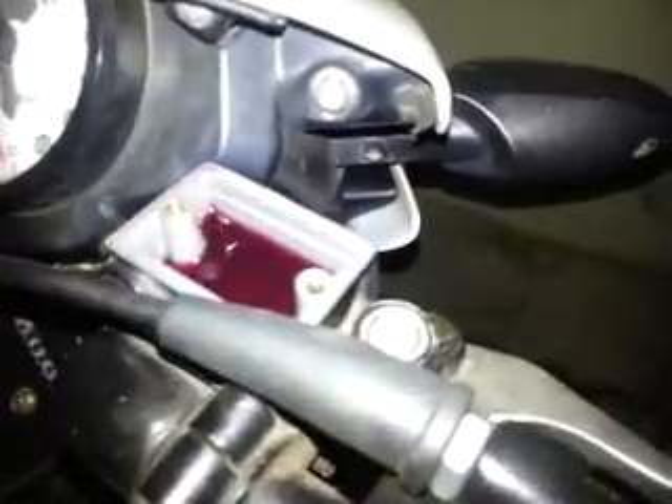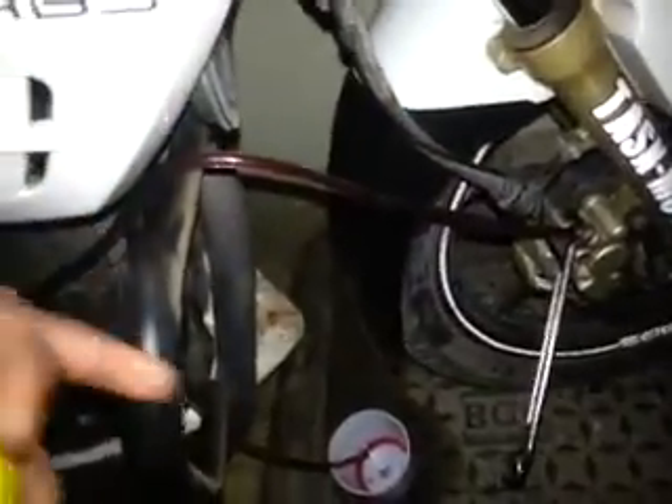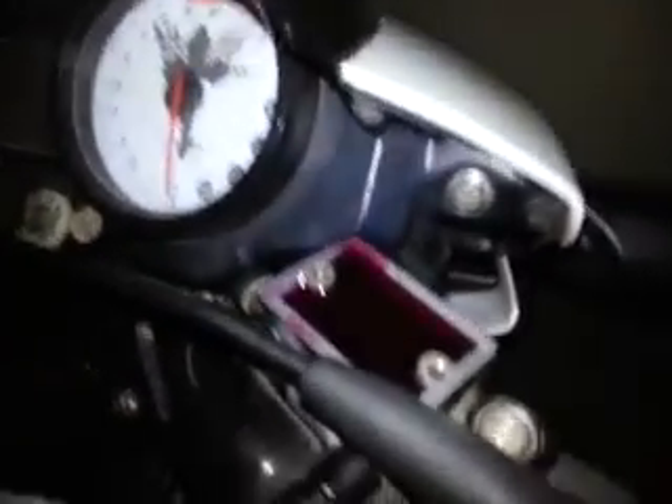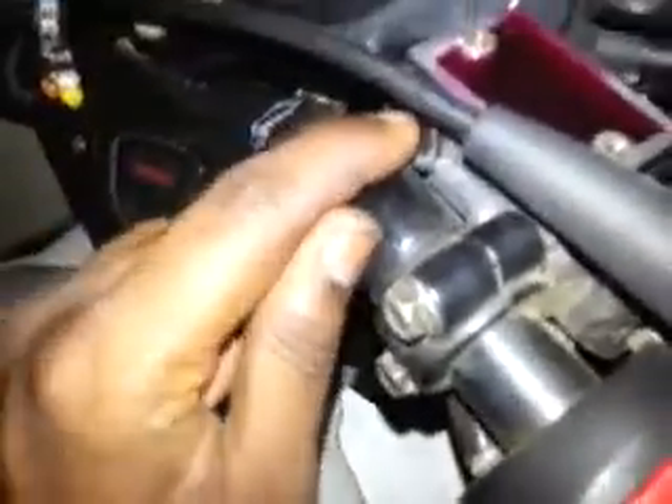As you can see, the oil has passed through the pipe and is getting collected down below. So let's do a refill. I slipped and poured a bit too much, but that's okay — just pump and bleed until you get the right amount. Then stop the procedure, replace your refill cap, and that's it — you have bled out your system completely.